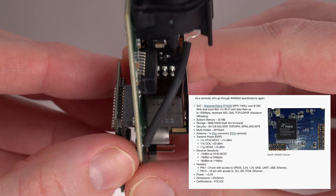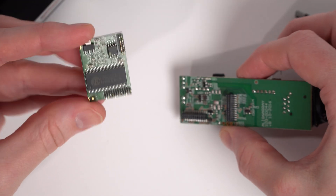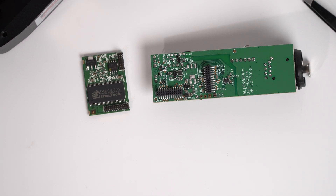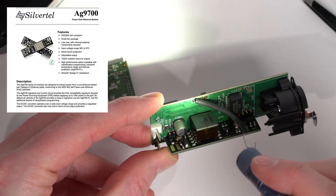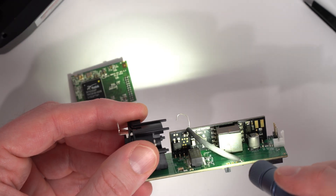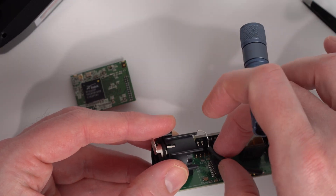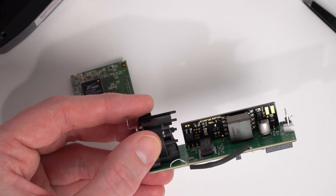Unfortunately, this is where the Aligner A3 as a product in 2024 runs into a bit of a snag. The AWM002 from AsiaRF is an older development platform that's no longer supported by OpenWRT and therefore cannot receive the latest kernel updates. The older versions of the kernel that this is running contain known security vulnerabilities that OpenWRT says are being actively targeted, potentially by advanced and likely state-operated or affiliated actors. Depending on how you use them and where you put them on your network, it may or may not be an issue that concerns you.